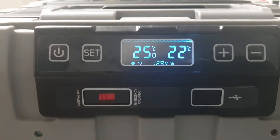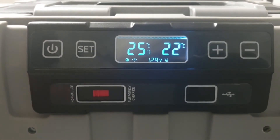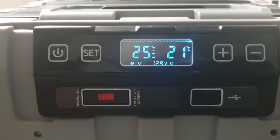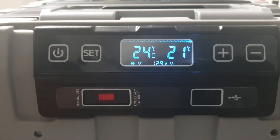The Travelmate and Evercool range also has an emergency override switch. Always leave it on normal use unless you absolutely need the fridge to keep running below 11 volts. Flicking it to emergency override makes the compressor run 24/7 — it will not shut down. Only use this in extreme circumstances — try everything else first and perhaps contact a fridge technician before touching this setting. If you leave the fridge in emergency override with the compressor running continuously, you will eventually burn out the compressor and destroy your fridge. If you do use it, get it to an Evercool repair specialist as quickly as possible.